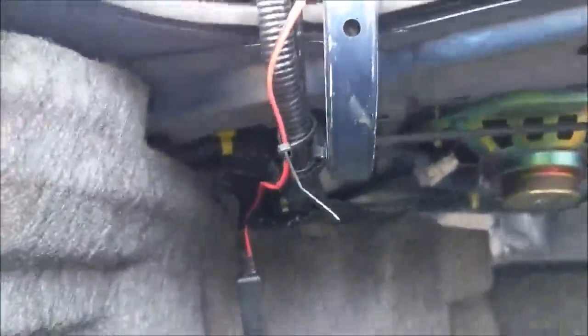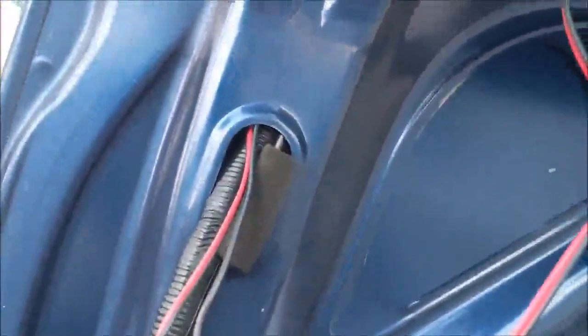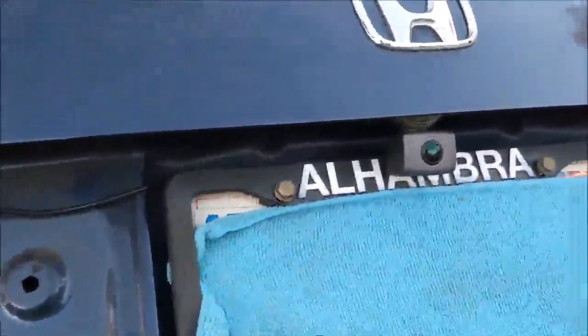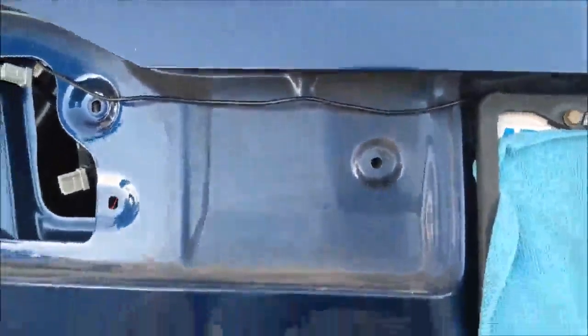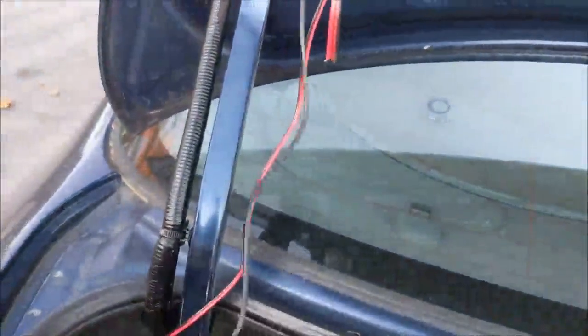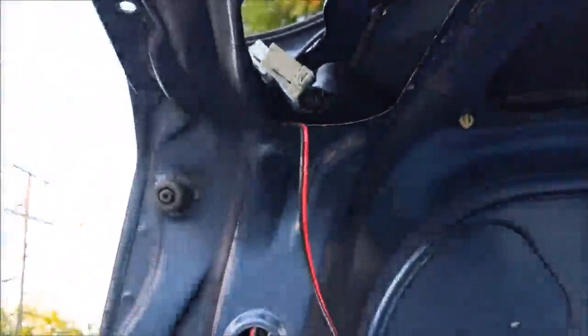I ran it up the trunk hinge and I'm going to zip tie it. You have to make sure you give enough slack because when you close the trunk the hinge bends backwards, so you don't want too much stress on the actual wire. I fed the black camera cable through the top first. I put the camera down there and ran it behind. I took off the brake light — that's the only hard part on this car. The camera can't fit through the tiny hole, so I just ran a small adapter through the back side, and the power wire goes up to the brake light the same way.